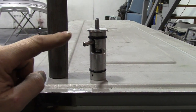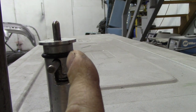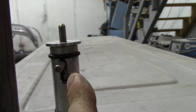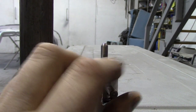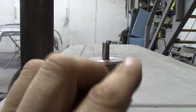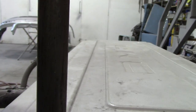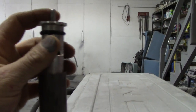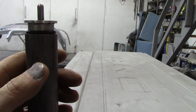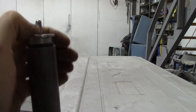Now, the barrel lock has a handle that unscrews and slides back and forth - that's what opens the pins. You've got to mark on your tube where you need to cut it out for the handle to come through. The handle unscrews like so. You need to measure from here to here because you don't want to be cutting in the wrong spot. See - the barrel would push into this tube, and then you have to cut an opening so your handle can slide up and down.